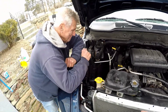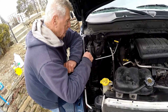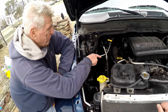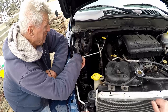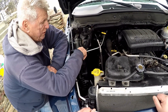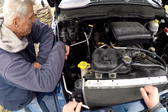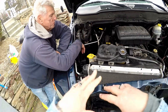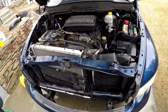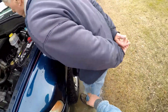The Mercedes plugs are deep too. The eight-cylinder Mercedes has 16 spark plugs — dual plugs, two per cylinder. It makes a bigger flame front, which increases power and fuel efficiency.